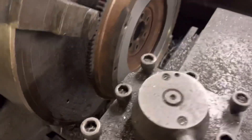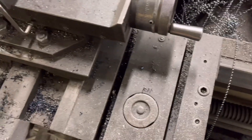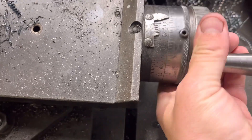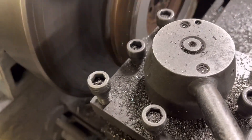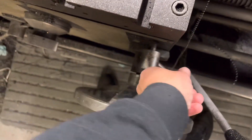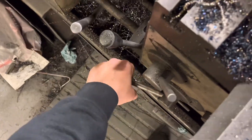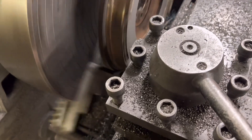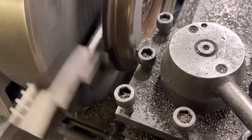So we're just going to bring it forward now. We wind this cross slide back, bring the tool back, wind the bed forward, put the cross slide on zero, then move the whole lot over so it just touches on that step. We lock that slide off, put a 20 thou cut on, lock the cross slide, pull up the handle for the feed. That's 20 thou — two more of those after that and we're away.